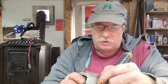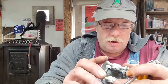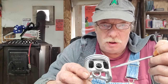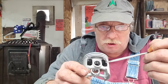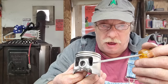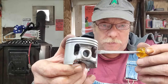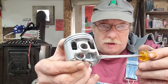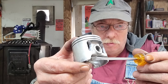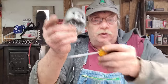There's so much more going on here than meets the eye, and I'll cover this more in another video. What I did was take out approximately 100 thousandths — mostly on the primary side — and cleaned up the secondary side. I cleaned them up and came to a known measurement on two of them. I still have to finish the other two. Now — knock your sharp edges off, knock those points off. All those rough edges will make marks in your cylinder. Break that edge nicely, fairly smooth.